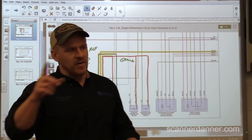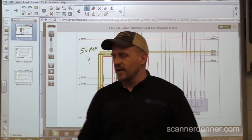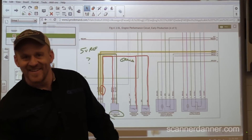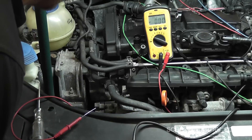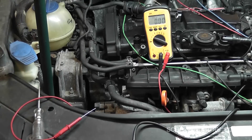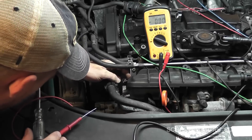We can confirm bad sensor grounds by checking a couple of others. The sensor ground circuit is brown-and-blue. Back-probing the cam sensor connector on the brown-and-blue wire, it reads 4.2 volts — same bad ground. So it's not just affecting the cam sensor; it's affecting other sensors on this car. I'll also check the ECT — and yes, the ECT ground reads 4.2 volts. Same circuit, bad sensor ground. No wonder he couldn't fix this car.